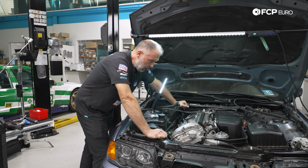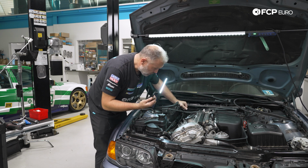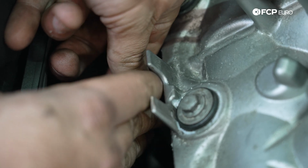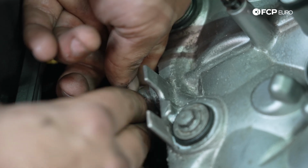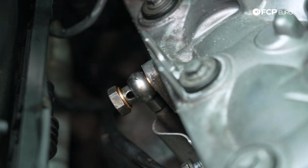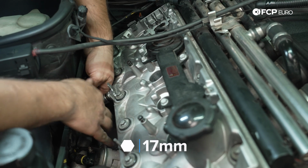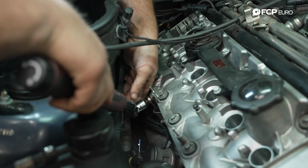So next up, since the valve cover is installed, we need to reinstall this banjo bolt for the PCV oil return. Put brand new crush washers on the banjo bolt. Not really a lot of room to work with here, so I'll kind of feed the crush washer in as I'm pushing the banjo bolt like that, so that it actually lines up. Start the bolt by hand. Make sure that it's threading, which it is. It was a 17 millimeter, so I'll use a small ratchet to get it started even more. Torque spec for this banjo bolt is 19 Newton meters.